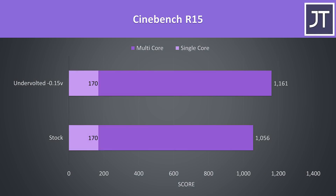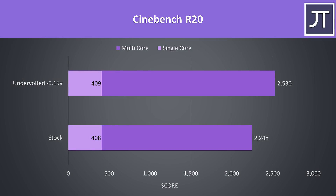To demonstrate how this translates into performance I've got some Cinebench CPU benchmarks. For reference the i7-8750H without any constraints should average around the 1230 mark for multicore, so the power limit throttling was affecting the result, though undervolting does help a bit. I've also got results from Cinebench R20, and similar deal — full performance wasn't reached due to power limit throttling, and even taking the undervolt further it was still over 300 points below other laptops tested, demonstrating an overall lack of CPU performance.